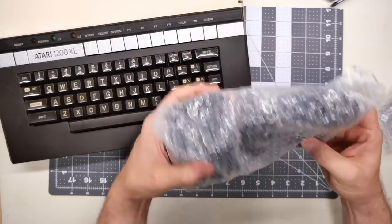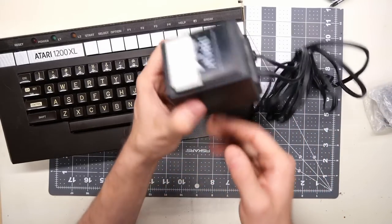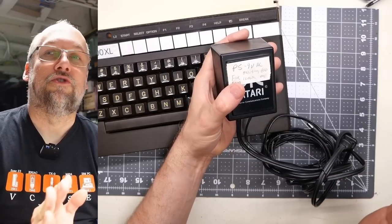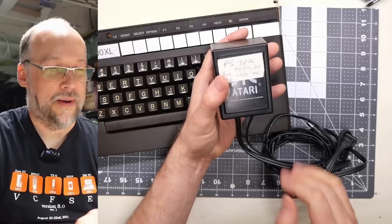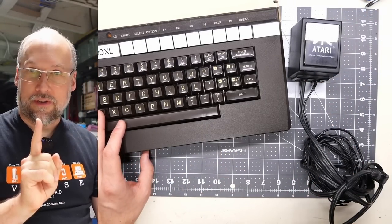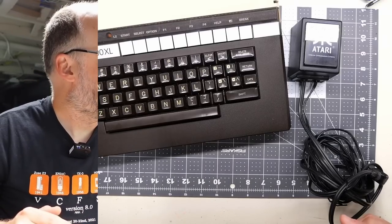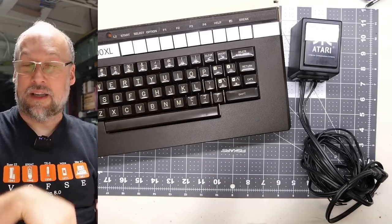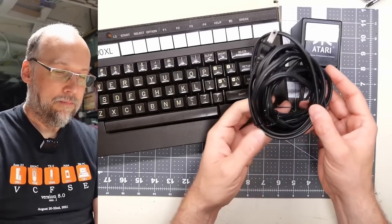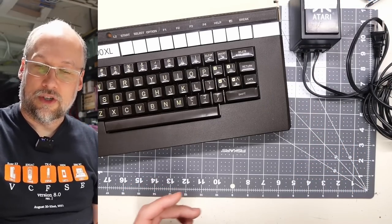Let's take a look at the power supply. The later 600XL and 800XL had a normal 5-volt input with a weird DIN connector. This one has 9 volts AC — the same type used on the disk drives and original 400 and 800, which also use an AC input. Inside, there's a rectifier power supply, so this thing is safe to use. I've heard that the 5-volt power supply used on the 800XL — similar to the one with the 64 — is dangerous to use. Somewhere on my desk I have a regular 5-volt switching power supply where I cut the end off and added a DIN connector, so I can use that with my 600XL and 800XLs safely.